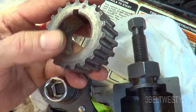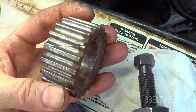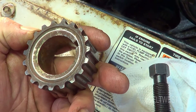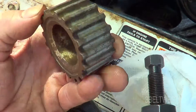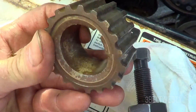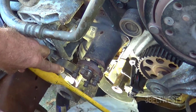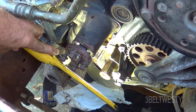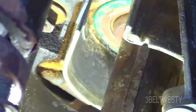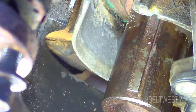Here's the sprocket I pulled off. This is the front side because there's the little timing mark. The back side looks like this — it's always a little bit dirtier, it faces the seal. I've gone through there and scrubbed with some brake cleaner and other stuff. It's got some score marks where it got dragged off. And the crankshaft down here — I bombed that with some brake cleaner so you can see the seal right there. Kind of blue looking. I'm probably going to have to take the crankshaft and get some of the burrs and crap off to get the sprocket back on.